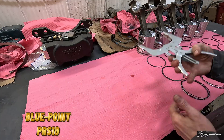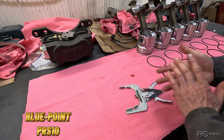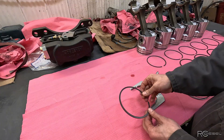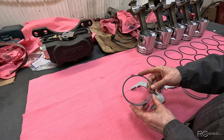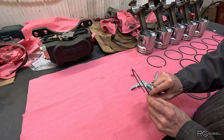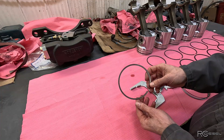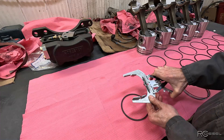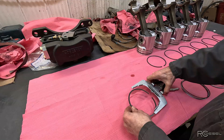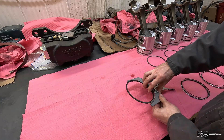I should explain this piston ring tool a little bit. It's very annoying to use because the handles are short and not very ergonomic — I just find them very slippery and frustrating to hang on to. They could have done these handles better in my opinion. The reason why I like to use these is that with piston rings, you never want to expand that ring any more than is absolutely necessary to get it over top of the piston. You need to go enough that the corners of the ring don't scratch the piston, but not so far that you stretch it or take the temper out of it — or in extreme cases, break it, because these are brittle and they do break. This tool opens and puts pressure on the outsides so you get a more uniform stretch on that ring. Lots of guys put these together with their fingers, but this way I know I haven't compromised that ring at all.